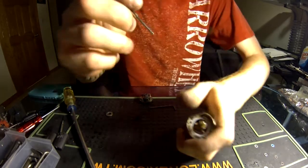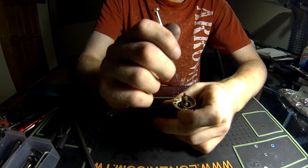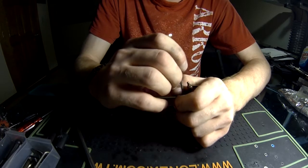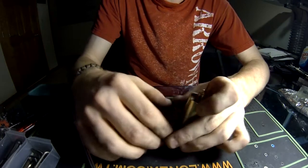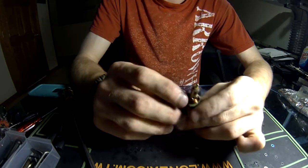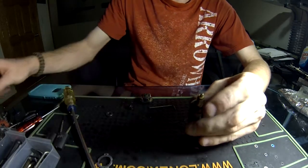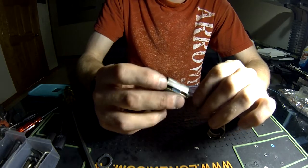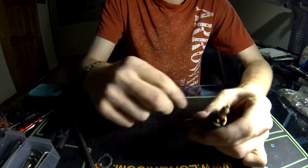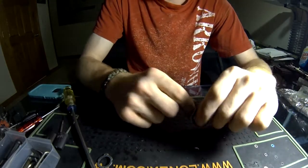Another thing you're going to want to look for when you shim: this clamp right here that holds the end bell down. While it's not necessary to have this, it's good to have it. But on Coyote armatures particularly, they use a lot of epoxy. That's what that blue junk is on the armature, to hold and balance the armature. So this epoxy right here, if it's shimmed too high up, it'll knock into this. And that's what happened with my FT at first, with my Franken torque motor, my DSG. It was messing up like that, and I was like, oh, why is it doing that? So I took it apart and found out that that was the problem, found wearing on the epoxy here. So I shimmed it a little differently, and voila, fixed the problem.